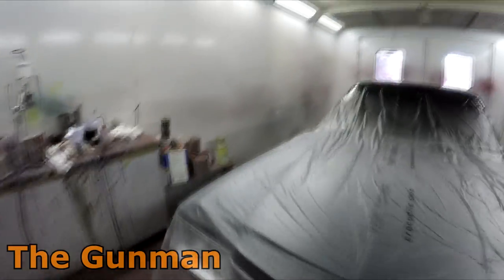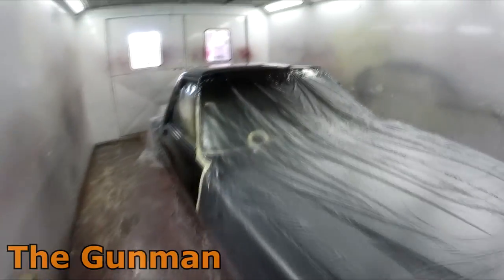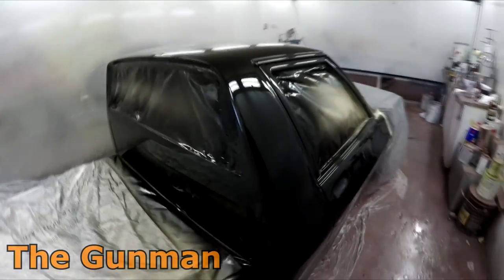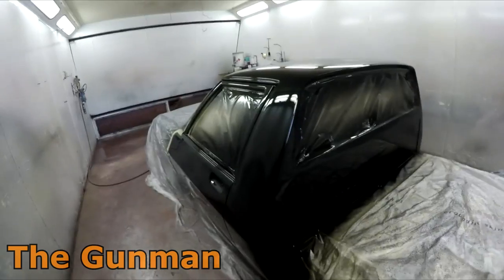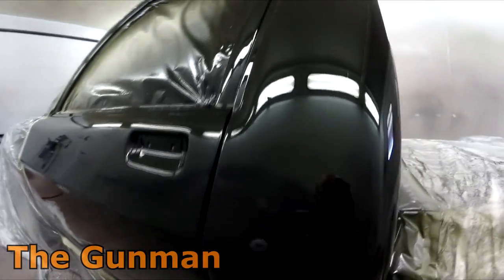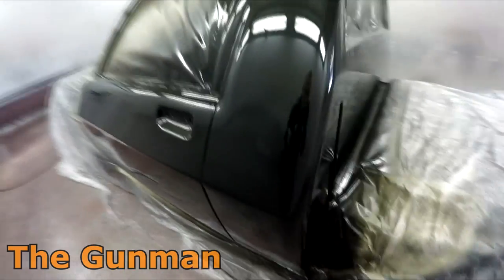Color blended out nice — I'll check that with my spray gun light, the Luma 3. Pretty happy with how it all went. Yeah, a bit of a pain with all that dust in it, but that's just painting — nothing that a polish will not fix. A little bit more polishing than I would have liked on a black car because blacks are obviously the worst to polish, it just takes quite a long time.